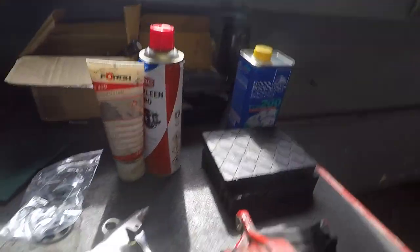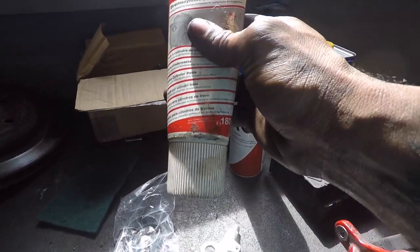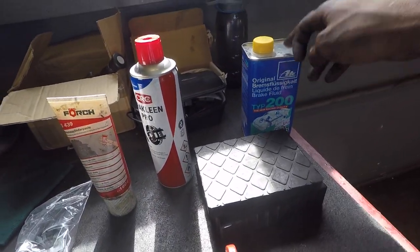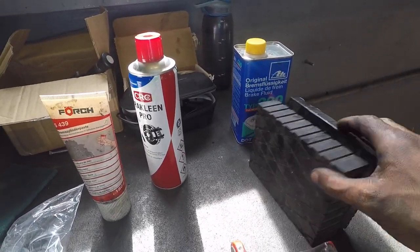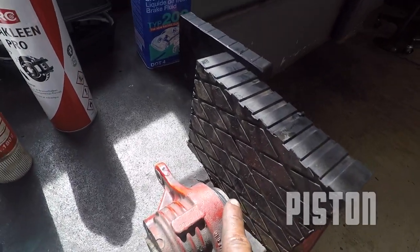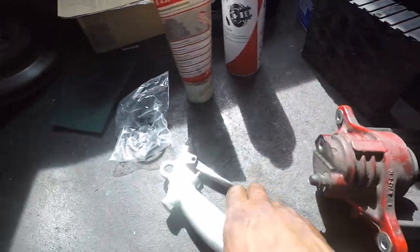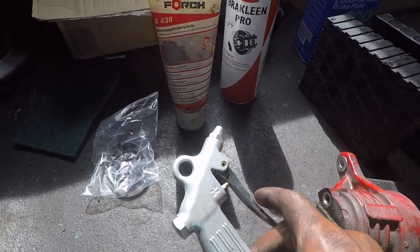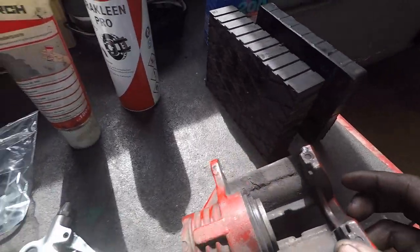Obviously you don't need a new caliper. You'll want some brake cleaner, some brake paste, and some brake fluid because you are going to lose some fluid. You'll also want some wooden or rubber blocks — those are so you can stop the caliper as you push the piston out so it doesn't go flying. I'm going to be using a compressed air method, though there are other ways to get these out without compressed air.